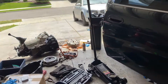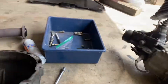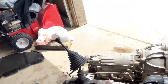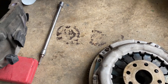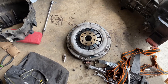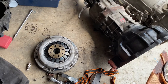I was putting all this together to make sure it all fits. I'm going to put the flywheel on and measure how much it needs to be machined down and get the holes machined. I found a machine shop that will do it — I just need to give them the spacer and they'll drill out those holes. I'm going to have my dad help me figure out how much it needs to be machined down, and then after the cat's out and everything, we can bolt up the transmission.